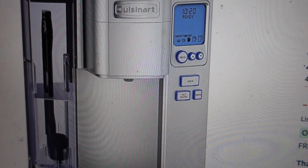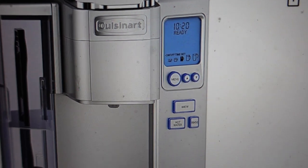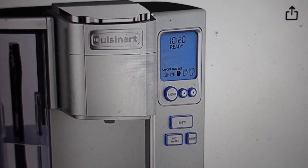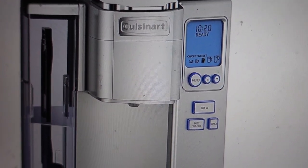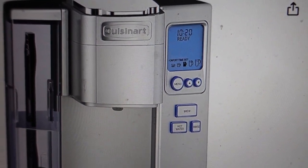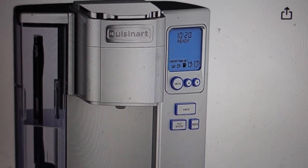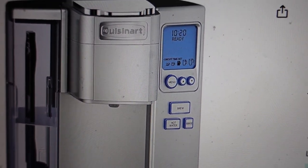But very often this EEO error is caused by the pump not working properly. The pump cannot work properly because the filter is clogged up or just because there's too much calcium buildup in the coffee maker that's preventing the smooth, clear flow of water. So what you want to do is to descale the coffee maker. If you run water and vinegar through it, or you can buy descaling tablets, then you can get everything cleared out and that should help the pump work properly again.